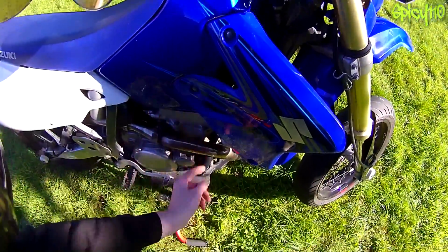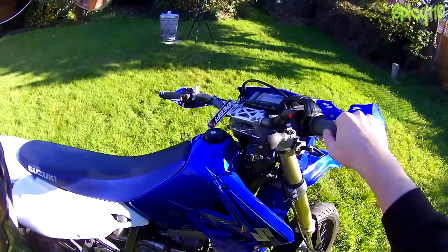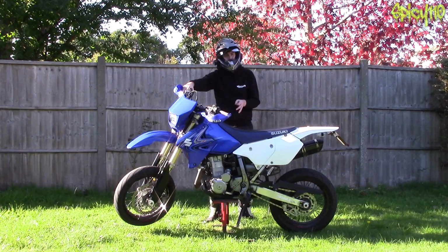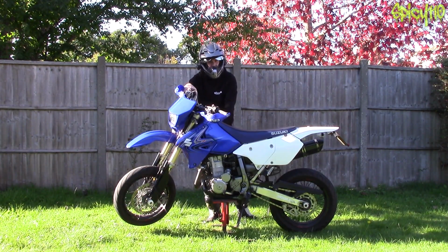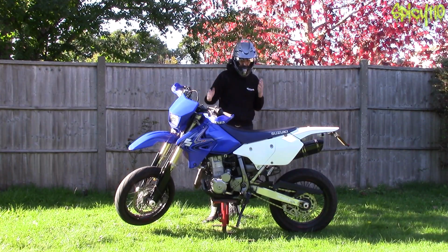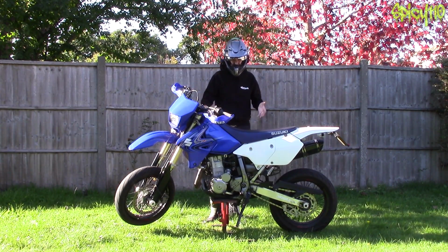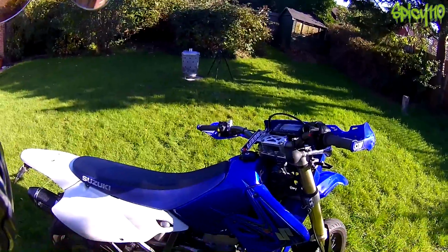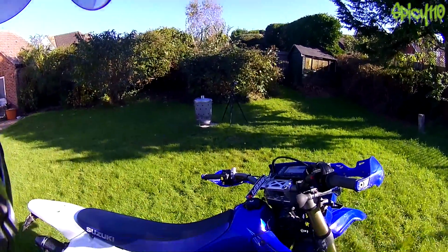There is literally a chain running top to bottom and there's a guide on it here. And you have to adjust that. You'll know your cam chain is loose because you'll be able to hear this little noise that you wouldn't normally hear from the engine. It's different on different models, but generally in single cylinders anyway, it's just this noise, like a tapping running sound on that side. As I say, it's very periodic and you only need to adjust that when it needs to be adjusted.